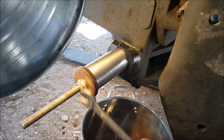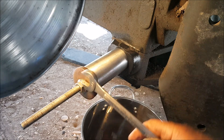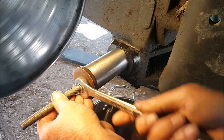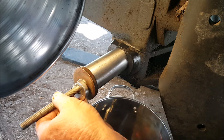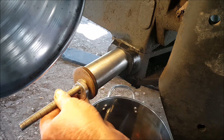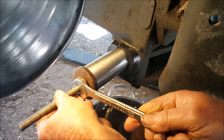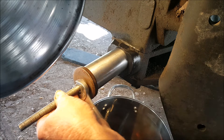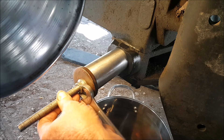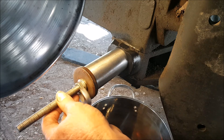When it comes out of there, I'll be able to put a new seal in it, put it back in place, slide that shaft back over this way, get it through the seal, and fill this thing back up with oil and be back in business. I've already done this to the other side about five or six months ago and it started leaking, so this is a tool I made for the other side and now I'm having to use it over here on this side.